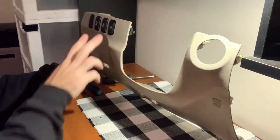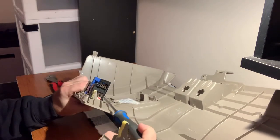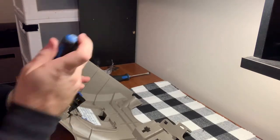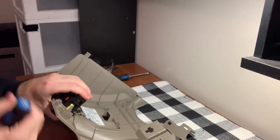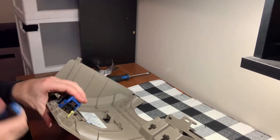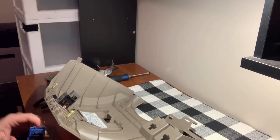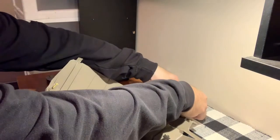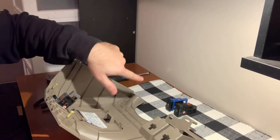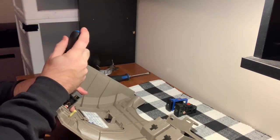Last but not least, these buttons — I'm going to change them out just like all the other ones. See that white with the red strip? Every single one of them has it. Pop this one out by pushing the tab in, it'll slide out, and the bulb is right there. The next one's bulb is in exactly the same spot. I've already got two out. You can also change the order of them — if you don't like your traction control button on the far left you can put it on the right. The wires are long enough to move them.